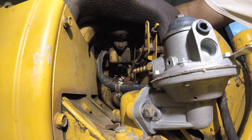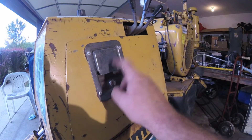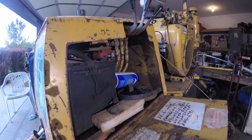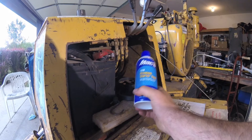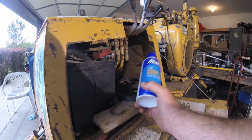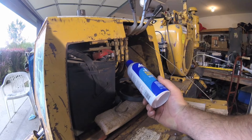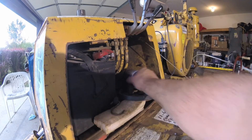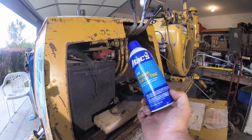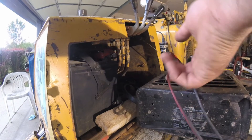Contact! I left the fucking key on for a week, god damn it. I was looking around trying to figure out where the battery was on this thing, finally found it in this door. I'm glad I did though, because if I hadn't I wouldn't have seen this — this is a bozo no-no of epic proportions. Don't ever leave a can of starting fluid next to the battery. Had a guy do this one time with an Ingersoll Rand air compressor — can bounced up, hit the positive and negative, dead shorted, exploded, burnt the thing to the ground. Really expensive — wiring harness, all kinds of shit.